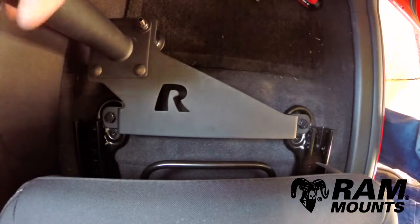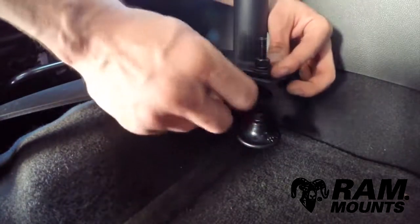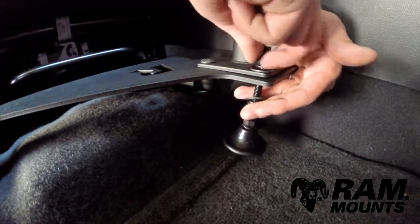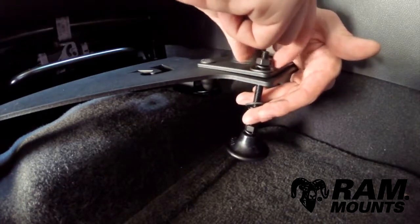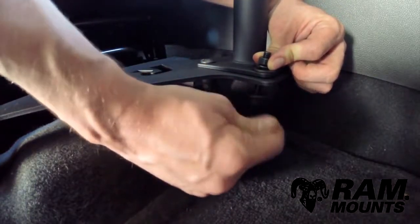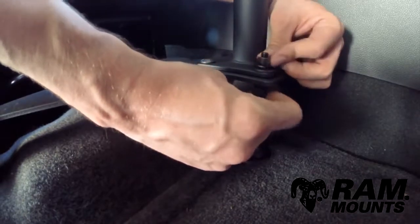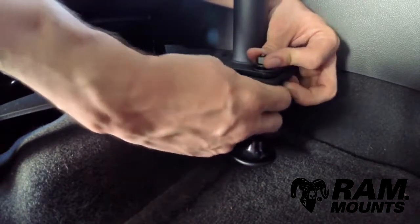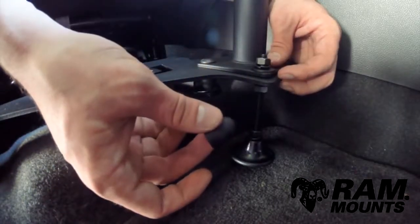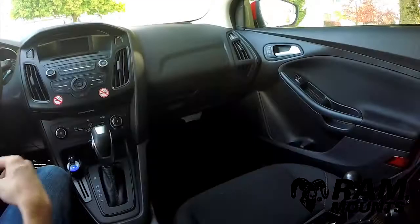The mount is now stable in place. The loose foot stabilizer at the end of the base flange still needs to be set. Spin the top nut to loosen it, which lowers the stabilizer downward until it contacts the floor. Then take the nut in the middle of the stabilizer and loosen it back upward so it braces onto the base, keeping the foot stabilizer completely steady. Adjust as needed — this varies from vehicle to vehicle. Place the spare rubber cap from the lower telescoping pole over the stabilizer bolt head.